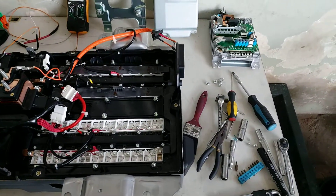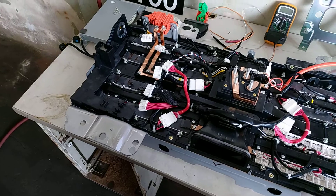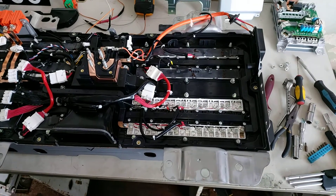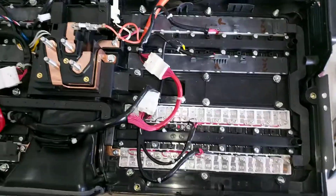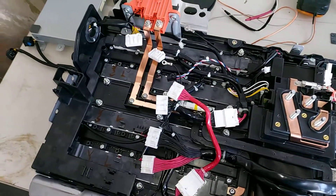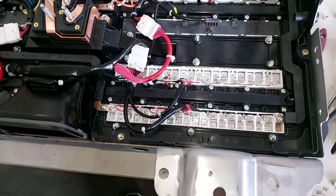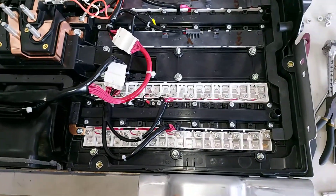We're still working on this 2017 Nissan Note E-Power, working right now with this 1.47 kilowatt-hours high voltage battery. This is a 285 volt lithium-ion, and basically this is just a demonstration video to show you the components and have a little review of how it works. We're having four groups of blocks with approximately 72 volts each one, with 3.5 volt individual lithium-ion cells.